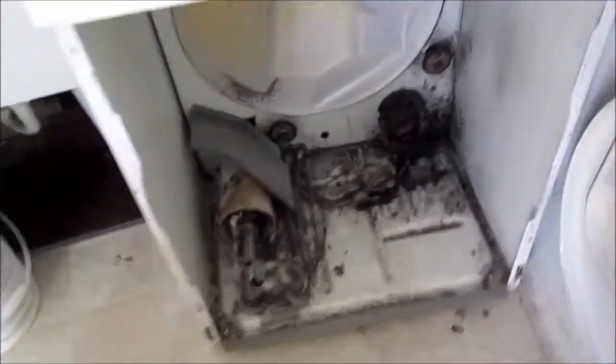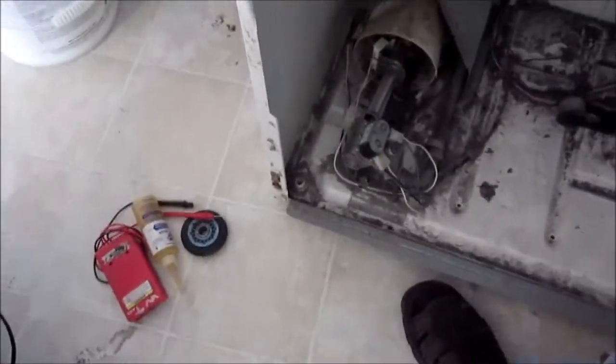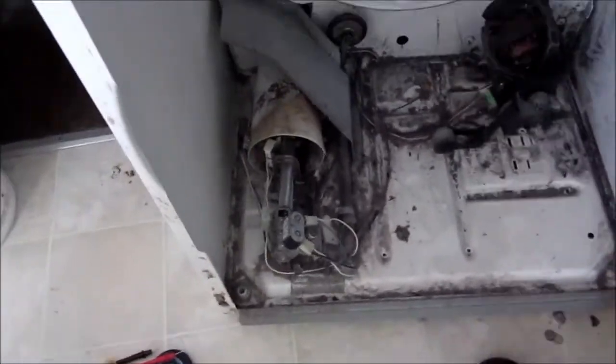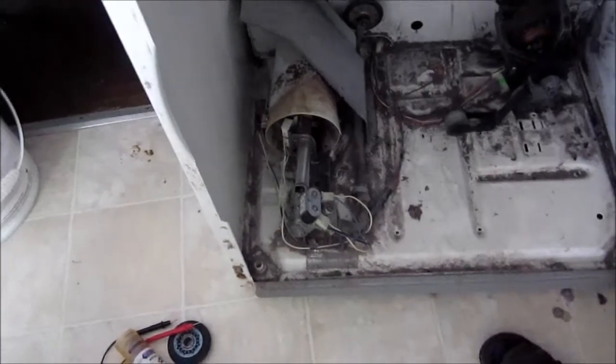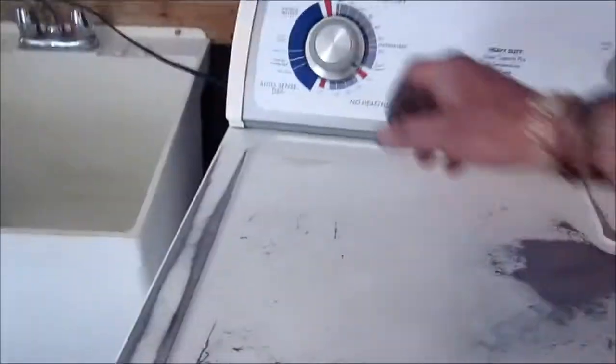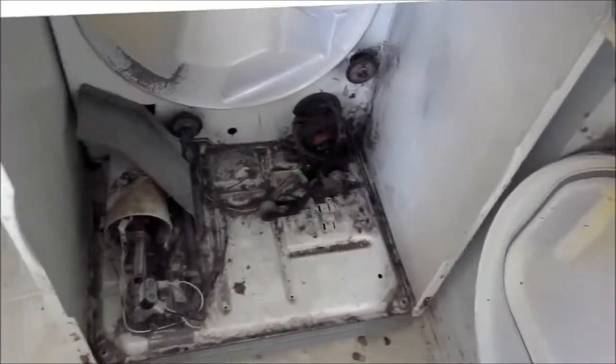What we want to do is try that about two or three times, because these coils can actually read good when they're cold — they'll show continuity when cold — and after you've heated them up a couple of times they'll go bad. So it's good to check the fire-up a couple of times before you figure it's fixed.